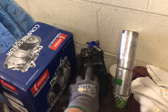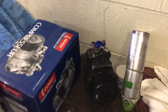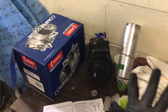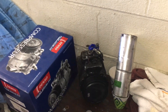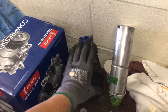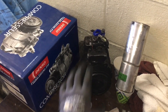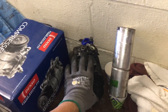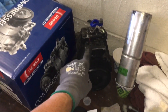Here are some of the states that compressors come in now: Denso comes with no oil in some cases, or partial, or full. You have to read the instructions, and you have to drain the oil — they don't always tell you anymore. This goes for all manufacturers and rebuilders. You'll get a compressor that is nearly completely dry other than assembly lubricant, so it has zero oil. Then you'll get another new compressor of the same make and model but maybe by someone else or a different year — it was packed and sat on a shelf and may only have the amount of oil needed for the compressor itself.